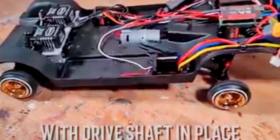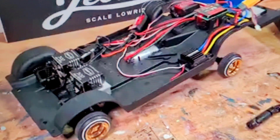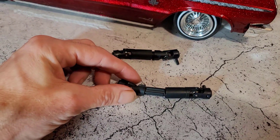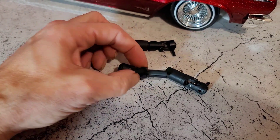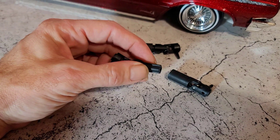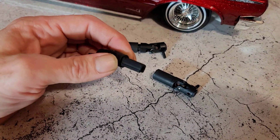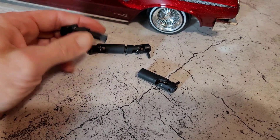We try to hop — same position — and it's way, way better. Basically the mod is not very complex. It consists of figuring out the exact point where the driveshaft is at max lift, and then from that point you file off the teeth from the inner shaft so that when it's at max lift it spins freely. Progress from people who've done this mod have also found that if you give a little pointing to the teeth on the inner gear shaft, it promotes them to re-engage a lot easier, which helps the re-engagement action.